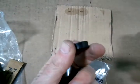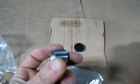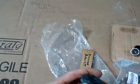It's just this little cup. Very inexpensive part, and you can buy rebuild kits all day long for only a couple of bucks. It pushes this piston, and the piston engages that rod, and that's what operates the clutch right here. It's all underneath inside that cylinder. So what we've done actually is we've gone at this in a little different way.